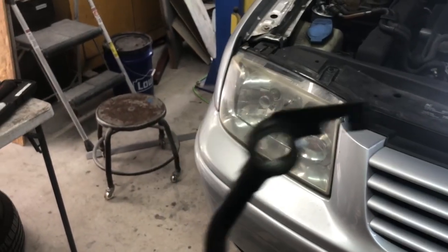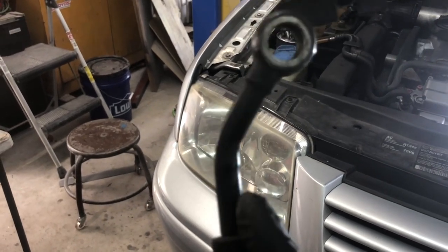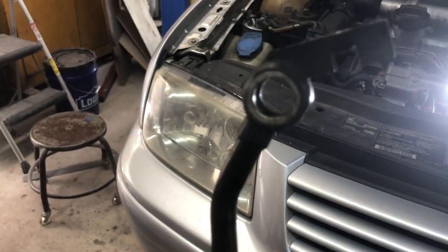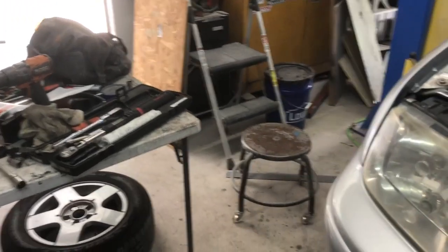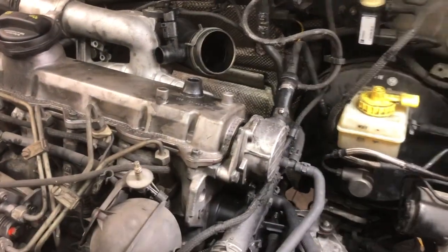But from another Jetta, here is a manual power steering line, and this angle on that line prevents it from fitting correctly. Now sometimes you can contour the rigid parts of the hose, and that can work, but in this case that's bending too far to try to put that 45-degree on it for it to lay over this way. So I opted not to use the line because I had the wrong one. But that is an option if you make sure you get the right line.